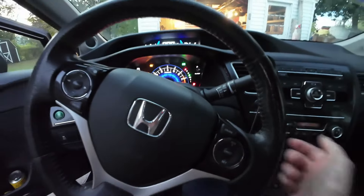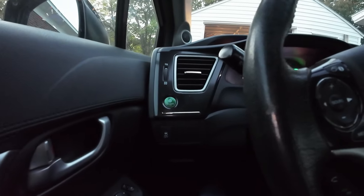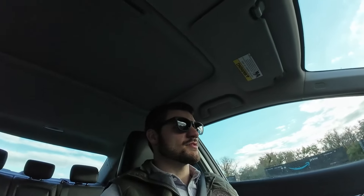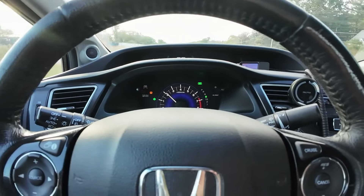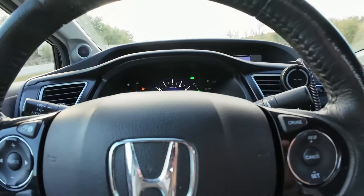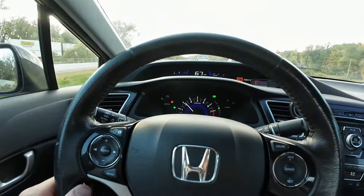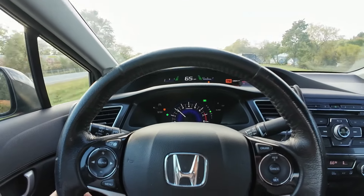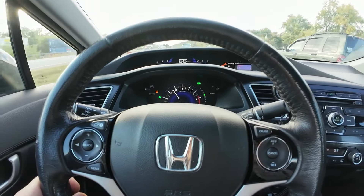Hopping inside, turning the ignition on — first of all, we've got eco mode. I'm going to show you a really cool feature this car has that I'm sure a lot of people know about, but I never knew. If you're just cruising in overdrive and you hit the gas pedal down to about half or a third throttle, it hits a hard spot right there, and it'll accelerate as fast as it can without downshifting. If you go any further, it'll downshift — pretty interesting.